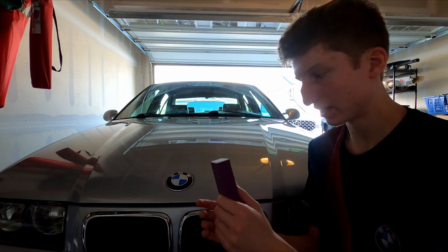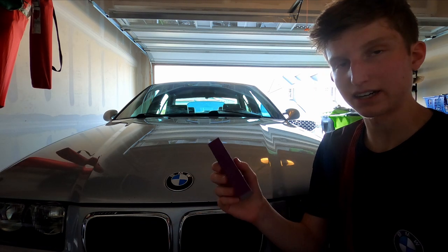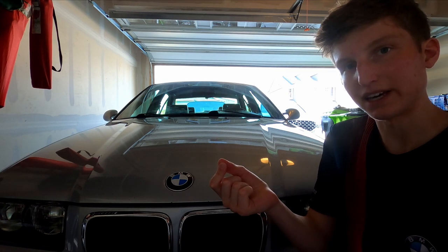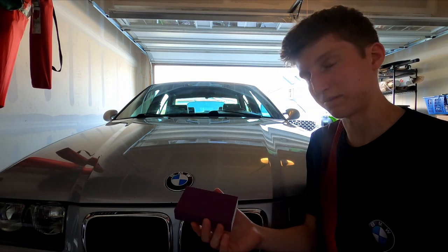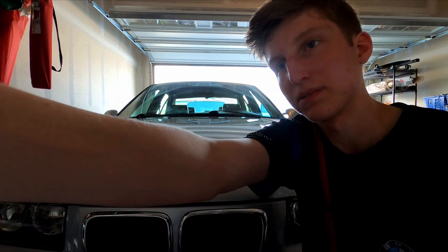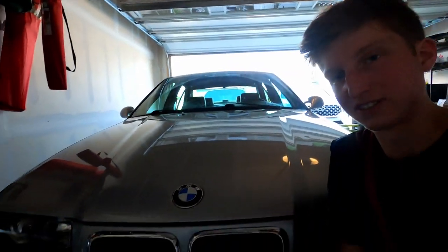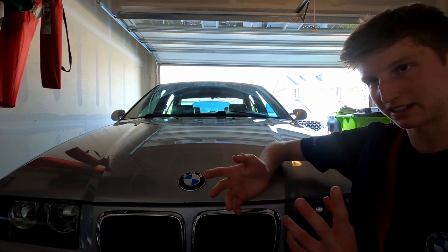To start off, I'm going to take my 80-grit sand block and use one of the corners to sand out the rock chip very carefully. 80-grit is really good for getting rust off, and the sand block is nice because you can use the edge and get very precise with it. They also make little sanding picks — kind of like a paintbrush — that are very precise for getting in there. So I'm going to start off by very lightly going back and forth inside the hole. This is a great example where I screwed up with the sand block — be careful, you can see those little scratches by the rock chip. Sometimes that's unavoidable, but try to let the sandpaper do the work.